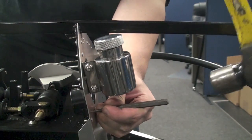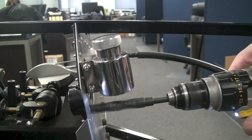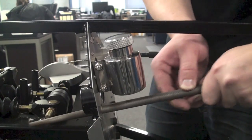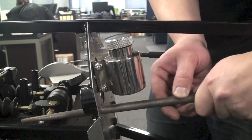With everything marked, go ahead and drill the five-eighths hole to pass the hose through. Make sure when you're done drilling the hole to use a round file to deburr the sides of the hole so it does not cut into the rubber tube.